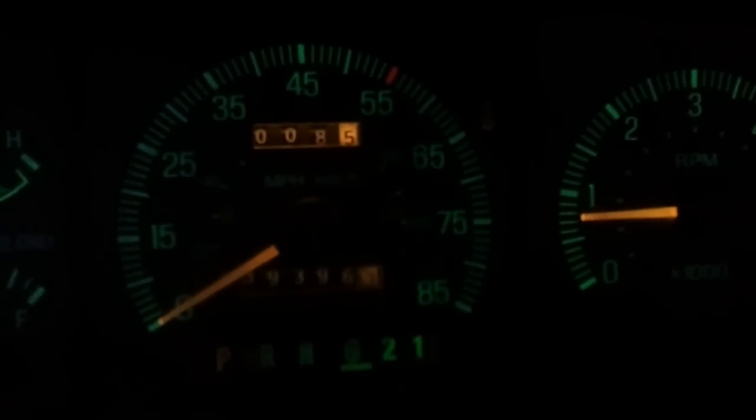With the SPOUT out you can see it's actually quite a bit higher. Remember, it was about 650 RPMs when I originally had it at 10 degrees with the SPOUT out. Now it's hovering above 700. So your RPMs are going to increase when you advance the timing. The factory recommends 650 RPM at 10 degrees — that's kind of how you know where you're at in degrees: if your RPMs are about 650, you're at the base 10-degree setting.